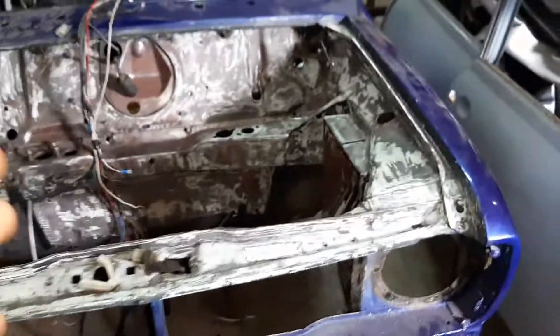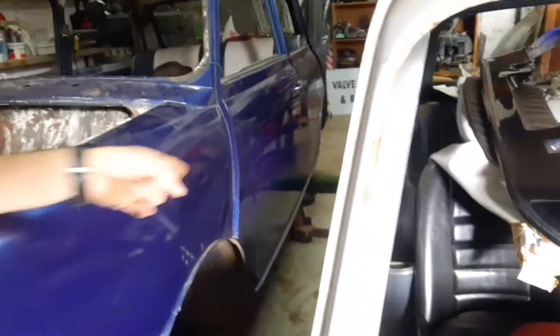First things first, I'm going to try and drill out as many of the spot welds as possible, which is really hard but we're going to try. I'm only going to chop in front of what I think is called the A-panel or scuttle panel — on the side of the door. I'm not cutting just yet though. First I'll get all of the spot welds in the engine bay, show you where those are, and then tackle them weld by weld. Really tedious — I'm just going to put on time lapse on the GoPro.